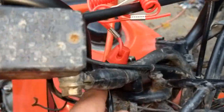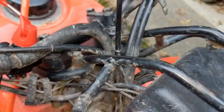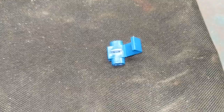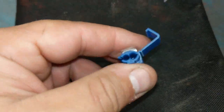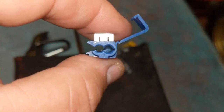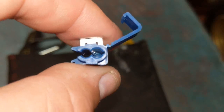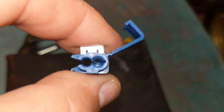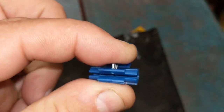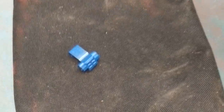I'm going to take this wiring harness off the new kill switch and run it into the headlight basket. I'll put it through the wire ties to make it nice and neat. This is the connector we're going to use — it's got two holes. On the left-hand side, it goes all the way through, so that's going to slide on your existing wire. On the right-hand side, there's a plastic stop — that's where you put your new wire. Make sure it goes all the way back to hit that plastic stop. Then take the metal piece and a pair of good pliers, squeeze it down, and that's going to pierce the insulation. Close your cap, snap it tight, and you've got a nice, good connection.